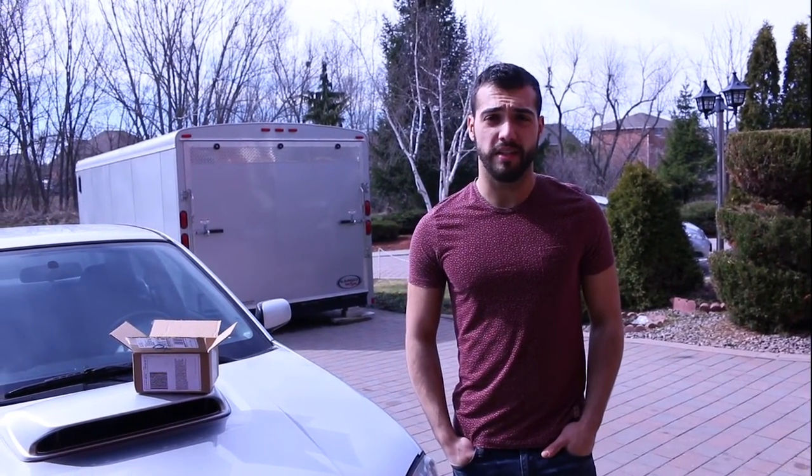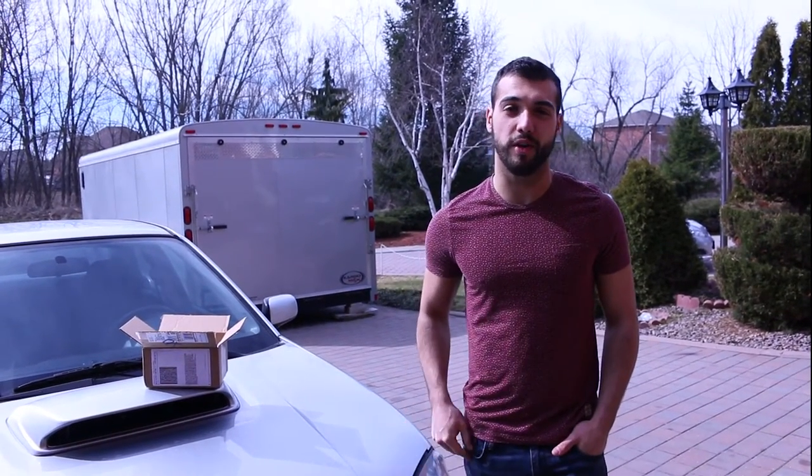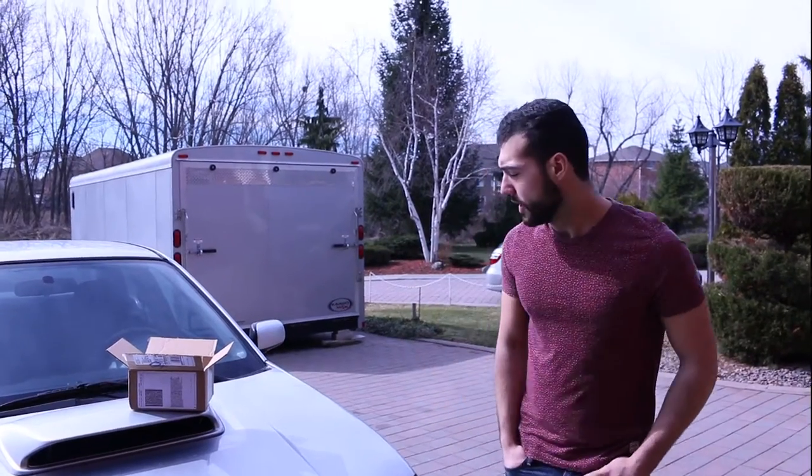This video is actually a double feature - we're gonna be doing a little bit of stuff on my STI as well. As you saw in my last video, we put the turbo back exhaust system on it. To go with that, I got a PTP turbo blanket to keep temperatures inside the engine bay down. We're gonna do before and after temperatures - run the car with no heat shield or turbo blanket at all, give you the temperatures the turbo runs at and the intercooler, then toss the PTP turbo blanket on and compare.